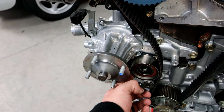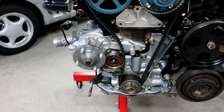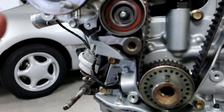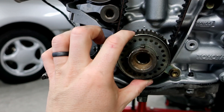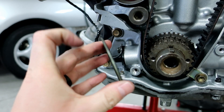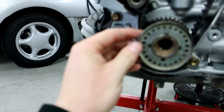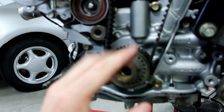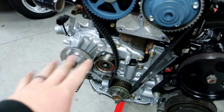Next we put the tensioner in, then I'll show you how to put the crank damper on and explain what this plate does. There's a little plate and it has a slight curvature to it. That curved side — the side that bevels out — you want to make sure that's put towards the belt. The whole point of it is to make sure the belt doesn't slip off. Once you put your crank damper on, this holds it tight against the belt so it doesn't slip. The top of your cam gears and everything else are left loose — that's what keeps the belt on. Very pertinent and important.